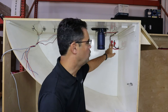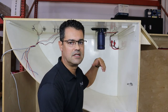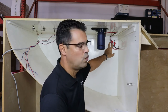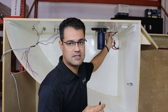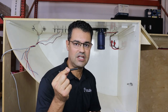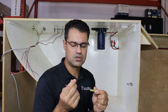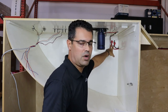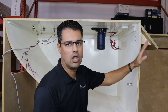We've put terminal blocks inside the anchor locker. Sometimes you'll see the solenoid up here, but in this case we've located it in the center console on the other side of this bulkhead. We use terminal blocks because of the wire gauge difference — the windlass on this V700 comes with 12 gauge wire, and if you try to hook it up to the six gauge recommended for this length of run, you cannot crimp it; this wire will not fit in the butt connector. So we went with terminals instead. I ran these two wires to those posts, then through the bulkhead, and now I'll walk you through all the way to the battery source.